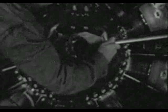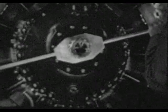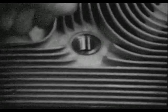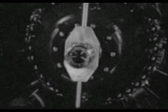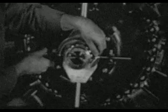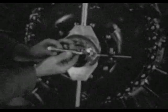Carefully place the propeller shaft turning bar in position on the shaft so as not to damage the shaft's spline. Rotate the propeller shaft counterclockwise until the number one piston is on its compression stroke. Determine the correct stroke by placing the thumb over the number one cylinder spark plug hole. When the piston is coming up on its compression stroke, the pressure will tend to force the thumb away from the hole. Install and tighten the timing pointer on the propeller shaft, and insert the top-center indicator in the front spark plug hole of the number one cylinder.